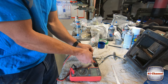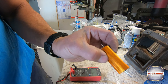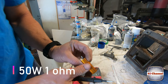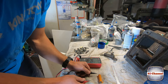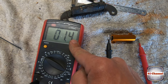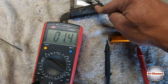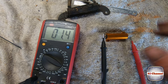So I've got nothing on this one — it's totally dead, it's cactus, there's nothing in it. But we're going to take this one and measure between here and here. Now this already says 1 ohm, which is pretty much where we want to be — between 1 and 1.3 ohms. So we've got 1.4 ohms across the resistor. We take that 0.4 away because that's what we had when we measured it at the beginning, and that gives us 1 ohm, which is exactly what this resistor is. This one came up with absolutely nothing, so that one's cactus. This will be our new replacement and that'll do the job.